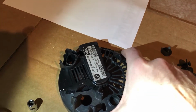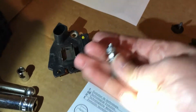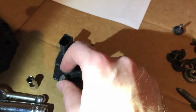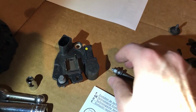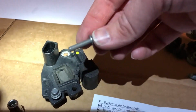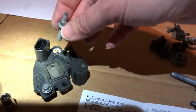Once you pull that off, this is what you're dealing with: the 7mm bolts on the bottom, and you can barely see them if you get a light up in there. So these two are not too hard to locate. The other one, for this top fastener, I was looking for another bolt like this and having a hard time finding it blindly because you can't really see up in there.